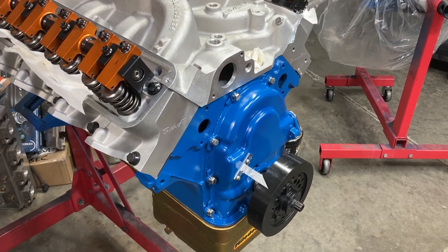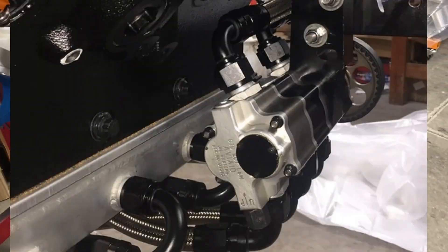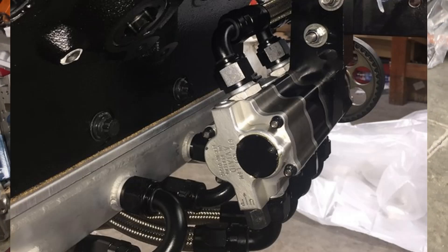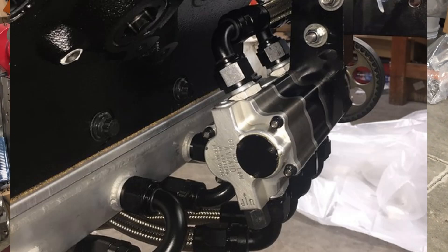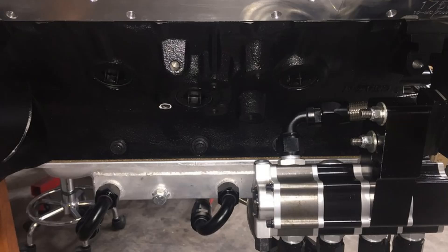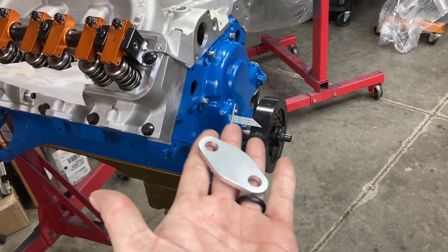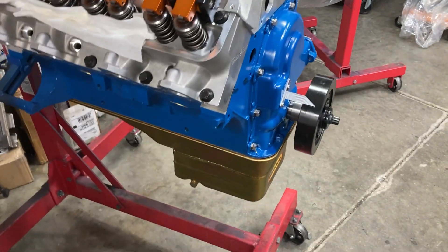In extreme situations we move to a dry sump pan. A dry sump pan — I'll throw up some pictures to show you — is basically just a cover for the pan rail of the block. There's no sump to it. You have multiple fittings on the side of the pan and an externally mounted dry sump pump. Dry sump pumps are driven by the crank; you don't have an oil pump inside the engine. We usually either drill and tap the feed for a pipe plug, or make nice little billet aluminum covers like this to cover the hole in the block.